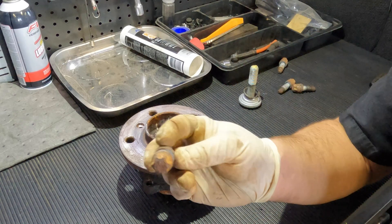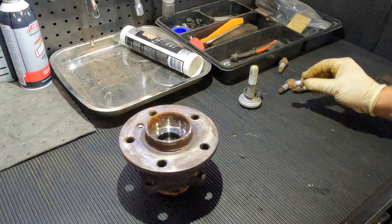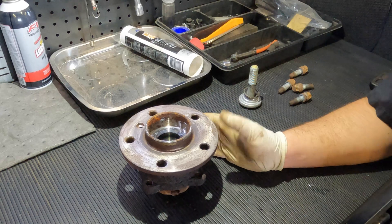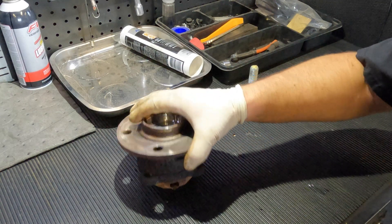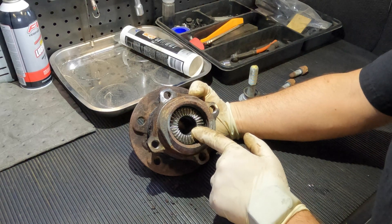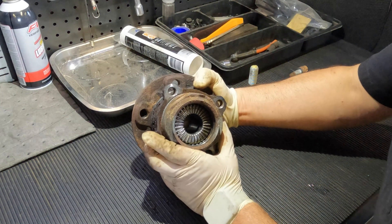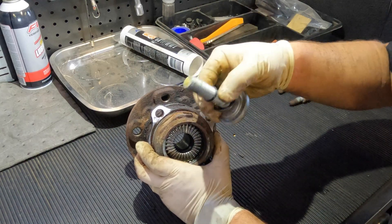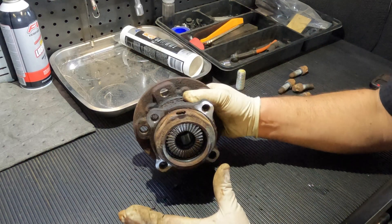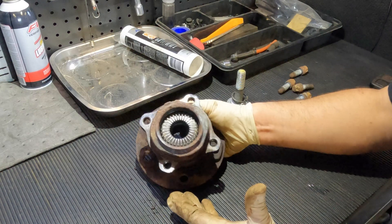The only thing I really do hate is that they use stupid hardware like this — E-Torx — which, if you've done this long enough, you know these will rust up and you can't get them off. But aside from that, if the bolts were just standard cutouts it would be just about the same as replacing any other wheel bearing. The hardest part is making sure the splines are correct. The way I did it was put the two together, put my axle nut bolt through, lightly tighten by hand, and rock the two until they mated. Then I was wiggling the wheel bearing making sure the axle would engage — any movement at the bearing should be moving the axle — and that's how I was able to lock it on.